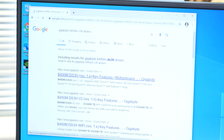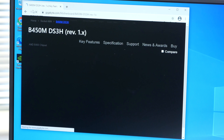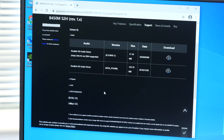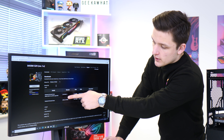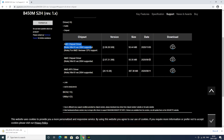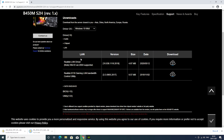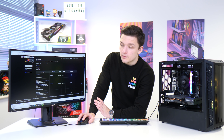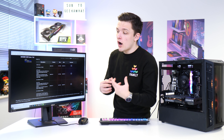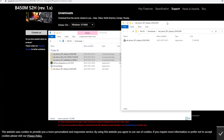The next thing we're going to do is install all the drivers for our motherboard. Grab the name of your motherboard, put it into Chrome with the word 'drivers' at the end, find the support tab, and select your OS — Windows 10 64-bit. We're installing the Realtek HD audio driver, chipset drivers, and LAN drivers for the ethernet port. Gigabyte also has an App Center and EasyTune program for overclocking RAM and CPU and monitoring temperatures, but that's a utility rather than a driver, so it won't directly improve performance — it's optional if you want to keep things simple.